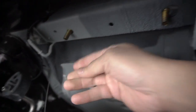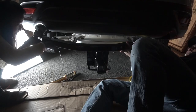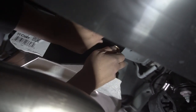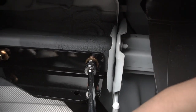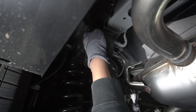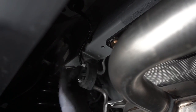Now we're going to attach the pigtails — you should be provided with four, one per bolt. I highly suggest you get help; thankfully my wife was there to help me lift this because it's fairly heavy. Feed the pigtail right through the hole, then close it up with the washer and hand tighten the bolt. Then use a ratchet first, and finally apply the torque wrench. The torque is specified in the instructions, so make sure you check that.